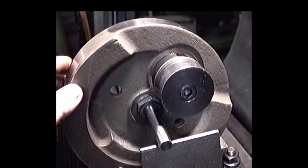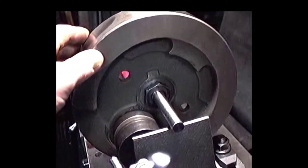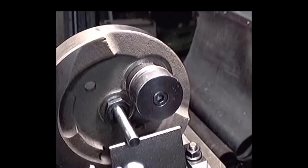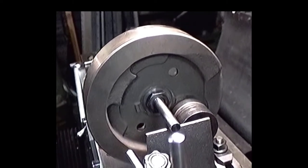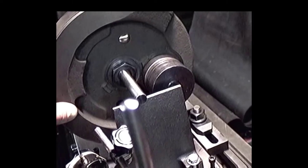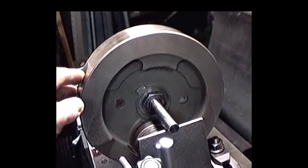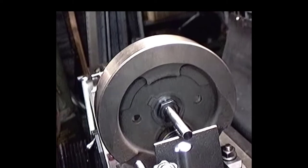Okay, now here's a left-hand flywheel out of a 1982-83 vintage 80-inch motor. We got this set up for like 58% on the bob weight, as you can see. Now, the interesting thing is this flywheel is heavy on the crank pin side. See, it's going to go down to the crank pin. It's pretty heavy, so we're going to take some weight out there. Now the right-hand flywheel was heavy towards the opposite, right in this webbing. So it indicates to me that we have a little bit of a vibrating motor, which was also indicated by the way the shafts looked and the way the flywheels were wearing and the tapers. So we'll get back to this in a second.